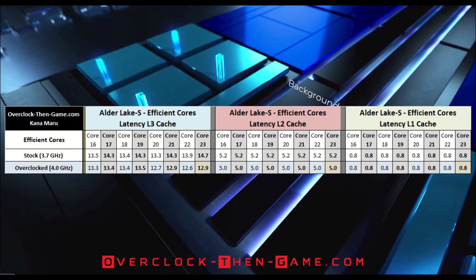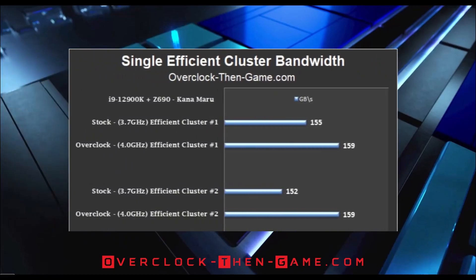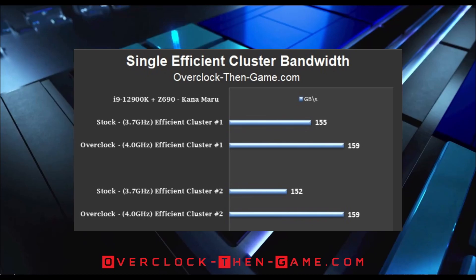Now we will look at various workloads while running the eCores at 4GHz. The final results will show how much data can pass through both clusters when they are working together. In my original video, while only using the eight eCores at 3.7GHz, I averaged 175.55 gigabytes a second across several workloads, and now I am averaging 187.09 gigabytes a second with the eCores overclocked to 4GHz. Separating the eCore cluster results, cluster number one increases by 4 gigabytes while cluster number two increases by 7 gigabytes. Cluster one totals 158.7 gigabytes a second and cluster two shows 158.92 gigabytes a second — they are now more or less equal in performance. That means if Intel's Thread Director and Windows 11 Scheduler ensure workloads stay within the cluster, we could see up to 318 gigabytes a second from the efficient cores.